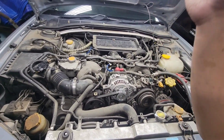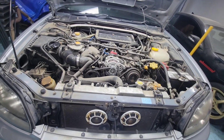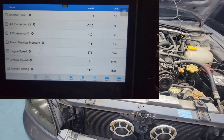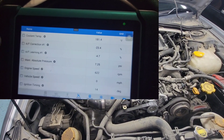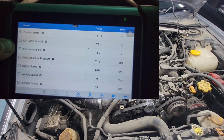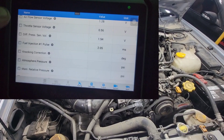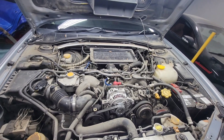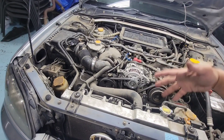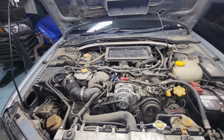Because of the rich condition on this side, this side is okay, but it has a little ticking sound. I grabbed the scan tool — you can see all the sensor parameters, inputs and outputs. The fuel correction air-fuel ratio is at negative 28. It says it's too much fuel. The ECU is trying to correct it but it's not doing anything — it just keeps dumping fuel.